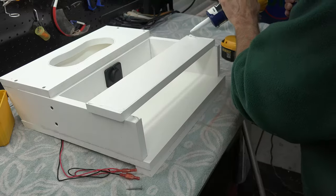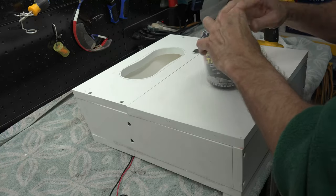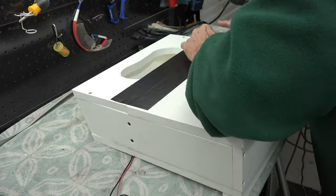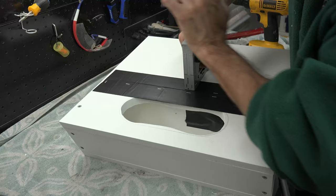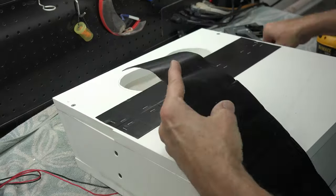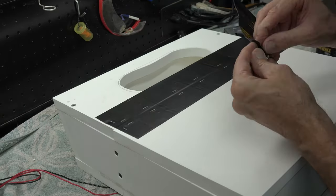Check your fit — it's okay if it's a little loose because you can cut the carpet to extend through the hole to keep it snug and tight when carpeting the box. Continue caulking and screwing the box together. For the lid we are going to use flex tape as a hinge — this stuff is waterproof just like you see in the commercials. Not having a metal hinge on the lid means we don't have to worry about a bulge under the carpet where you step, nor do we have to worry about anything rusting. I place some staples close to the joint to give it extra support so the tape does not pull up after lifting the lid up and down multiple times. I then add a little more overlapping tape in the opposite direction just for more support.